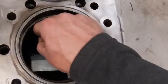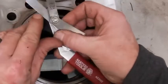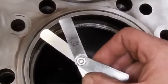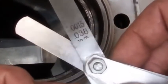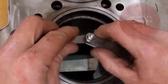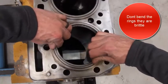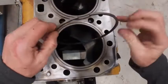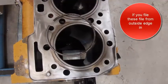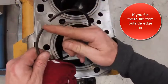That one should go in there — yep. So what you do is you add the 18 thousandths and the 15 ten-thousandths. I'm going to go back to my 20. When I pull these out of here, I want to pull them out evenly — I don't want to twist it like that, that'll break it. For some high performance applications like race cars, you'll have to file this end gap down.